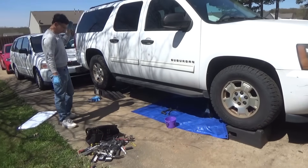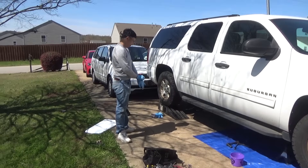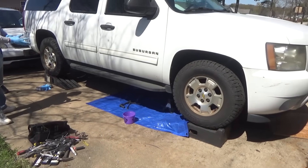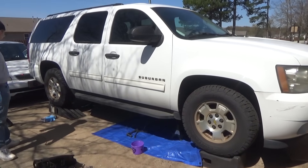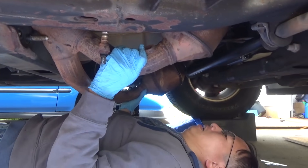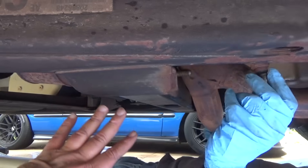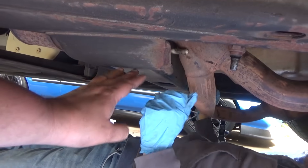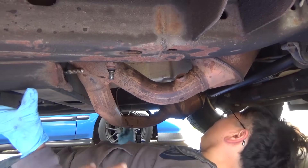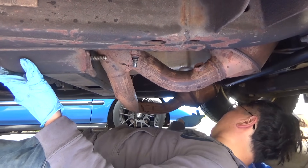We got the Suburban up and I got Billy over here - Billy's gonna be helping me today. Billy's been doing a lot of the work already, but we're gonna start pulling this transmission off so I could take it to the rebuild shop. Billy just got the exhaust hanging down, loosened those bolts. We got everything loosened up - the transmission cross member. Right now we're gonna get the jack to support the transmission so we could go ahead and pull all of this stuff off.